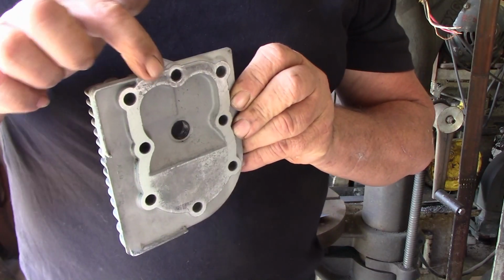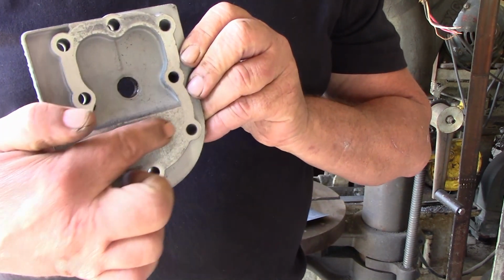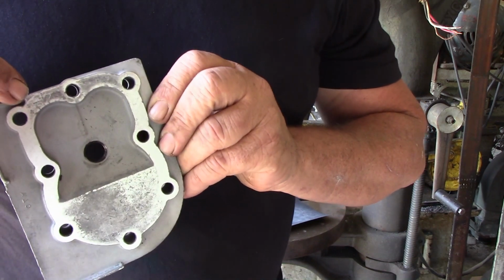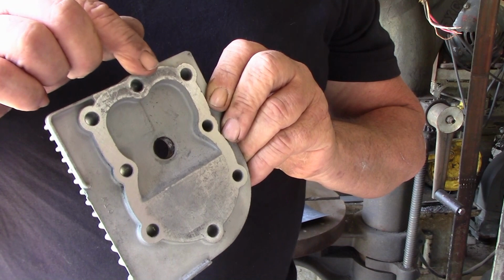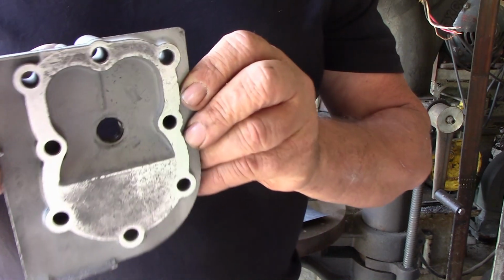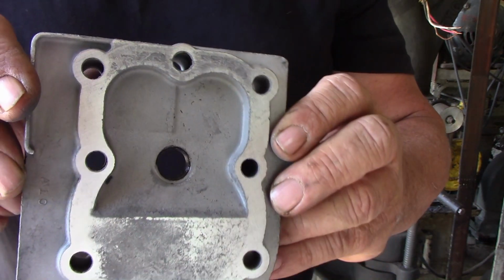It's looking a little better. We still have some dark up here in the area where the two valves were, but it's looking pretty good down here. The piston comes up just below this area. The valves are here, but like I say, usually around the exhaust valve more than the intake. But it's not uncommon for this to be the bad spot on them. I'm gonna get that a little bit better. It's partially hitting and getting some contact, but we're getting pretty close there.